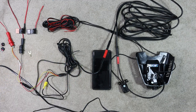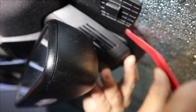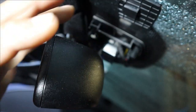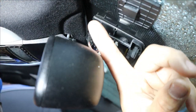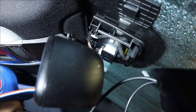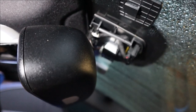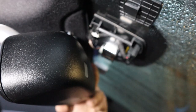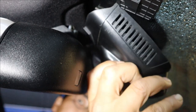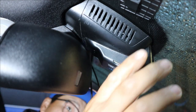Now let's bring this to the car and I'll show you guys how to install this dash cam. It basically just replaces the existing cover — we'll pry this down with a trim removal tool, get it in there and pry down. It has to sit right along this line here — that line has to line up with this part. This is where all your cables are, and you need to decide which one's going which way.